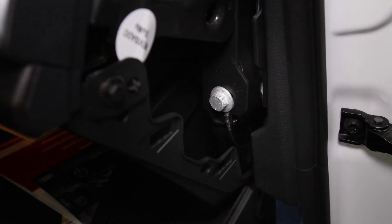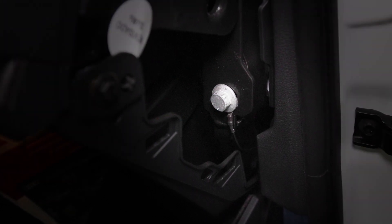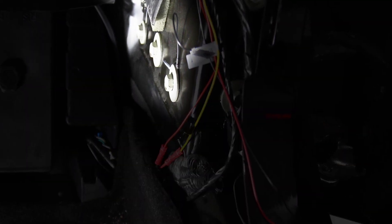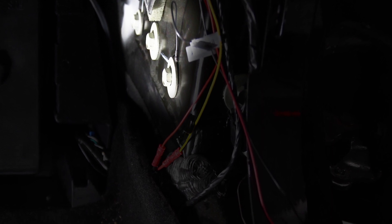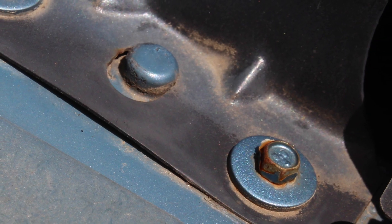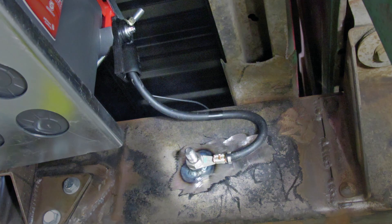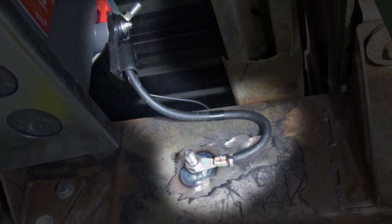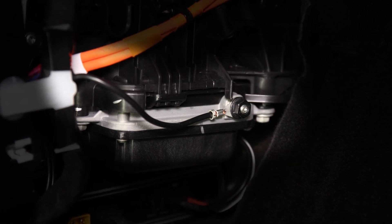Although factory ground points are the best, there are also alternative ground points to consider. Alternative ground points can be bolts, studs, and screws connected to your vehicle's frame. In some cases, all bare metal on your vehicle's body can be used as an alternative ground point, as long as it isn't interrupted by rust, paint, or anything else that may interrupt an electric current. There is also the option of manually installing your own ground point if you don't feel like searching your vehicle for another viable point. Though installing your own ground point is an option, it is best to use an already existing ground point if you're not confident with your installation capabilities.